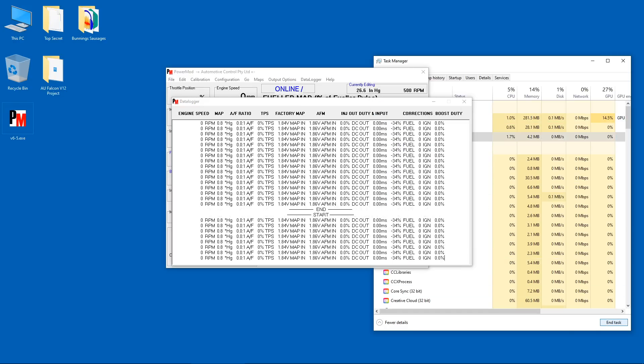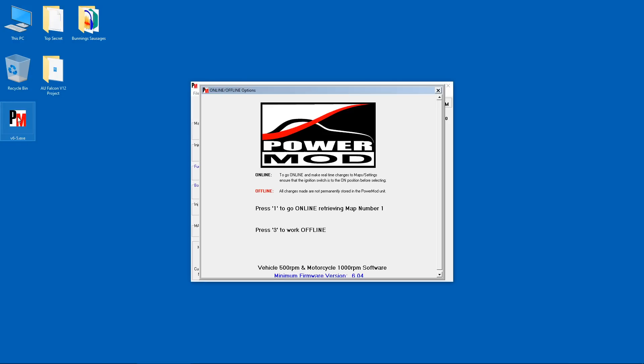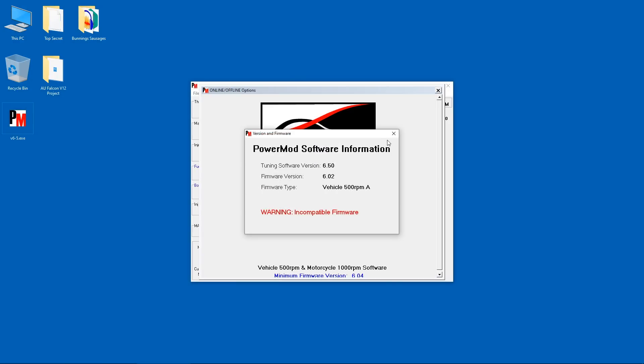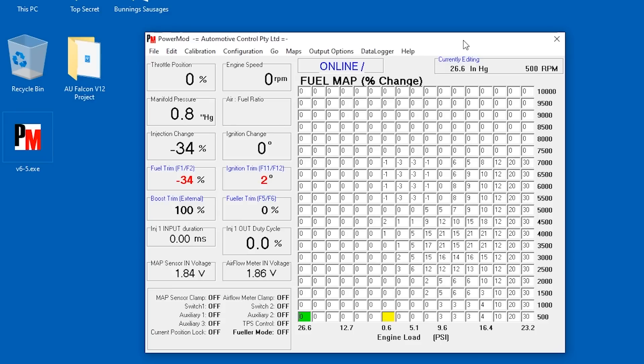It would be cool if someone could retune the car just to make sure it's running correctly on this thing. But I think the better thing for me to do would be to try and get this piggyback ECU removed. I contacted Real Dyno — it used to be called Redcliffe Dyno — and they don't tune these ECUs anymore, so it definitely is old fashioned technology. The unknown for me is how difficult it is to actually remove it, because I know it's controlling and driving the fuel injectors on this car directly, so I don't think you can just disconnect it and assume the car is going to run.